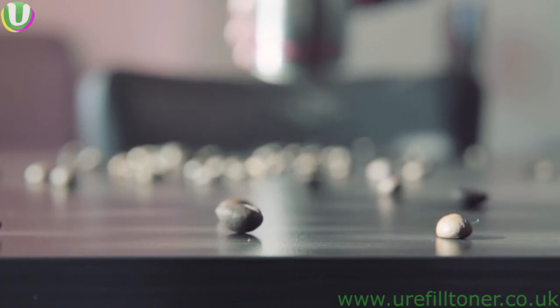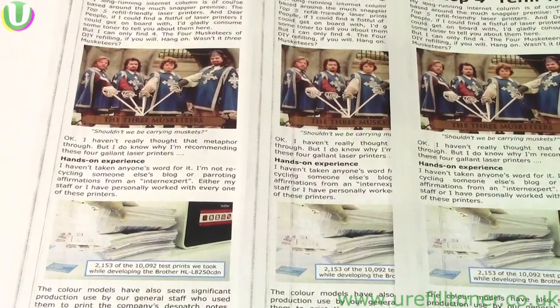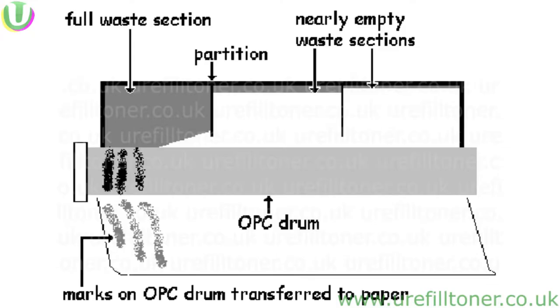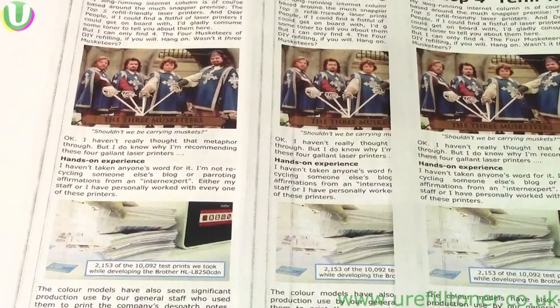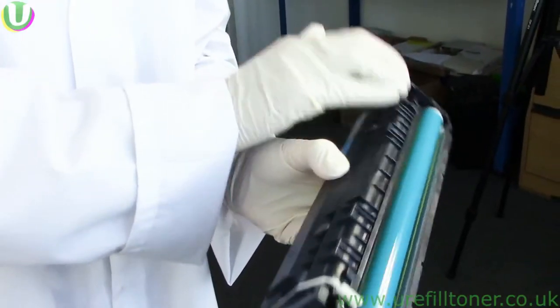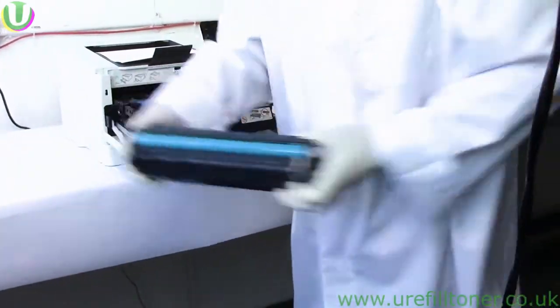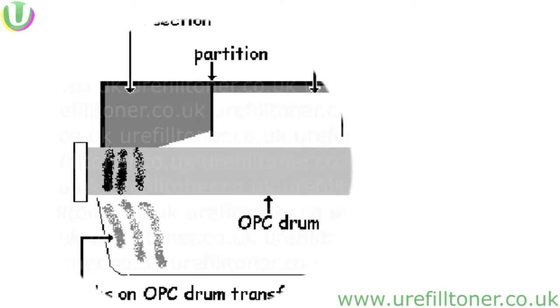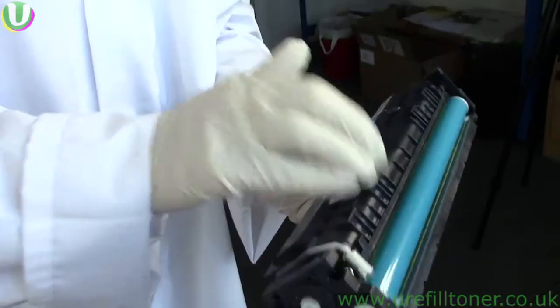Now I promised to spill the beans on waste overflow. When you print, not all of the toner can be persuaded to make the jump across from the OPC drum to the paper. That part of the toner that can't make the jump is scraped off the drum and put into a closed compartment. Eventually that waste builds up so much that it starts to touch the drum and you start to see streaks on the print. The first line of defence is to tap the outside of the waste compartment and shake the cartridge from side to side, to try and get the waste to even out so none of it is protruding forward and touching the drum. The slogan to remember this: Tap, Shake, Ameliorate.